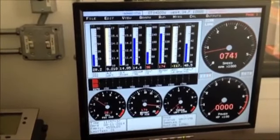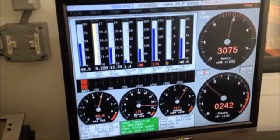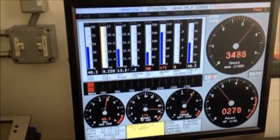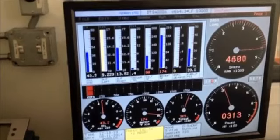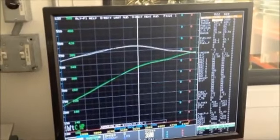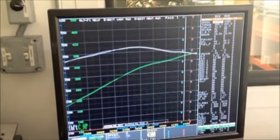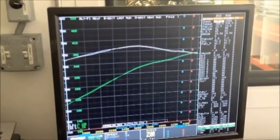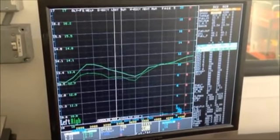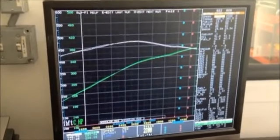Well, that's pretty cool. You're getting a little bit, and I have not seen the other wheel. That sounds good — it only went to 45. Let's see what it gets. I might have lost a little bit. I think we found the sweet spot with the timing. Lost a little horsepower — actually it's pretty close. Picked up a little bit downwards, less than one. You can see it was lean there, lean in the middle. The fact that we changed the timing and it didn't really lose any power tells me that we're doing good. No, I didn't hear any ping either. No, it hasn't pinged yet.